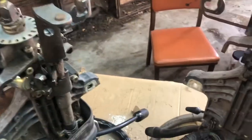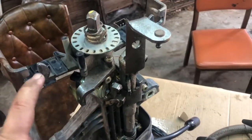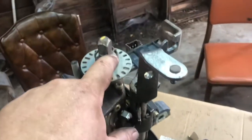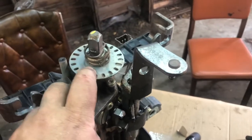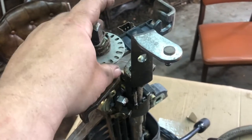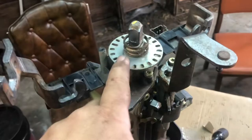The two columns are not identical. The difference is on the manual shift column versus the automatic — the automatic has this extra tab on the back of this bracket. If you pull these three bolts off, take this spring off, just pop a screwdriver in there and pop this little collector off. I believe this is for some models that might have had traction control — some of the Expeditions — and it might have something to do with steering angle sensing. These trucks didn't have them, so you pop that out.